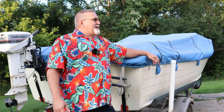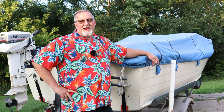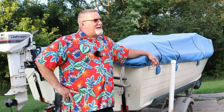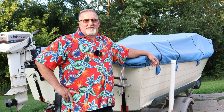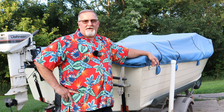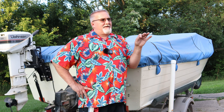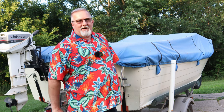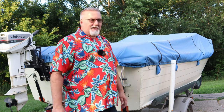Fine. What'd I do? I put a 30 amp on there thinking, oh, that's enough. Well, it was enough for my old trolling motor. It didn't draw the amps that this Ulterra will draw, and a 30 amp breaker, when I run it up at 8, I can run it up on 8 a lot. I go 9 or 10. If I go to 10, I can go about 100 yards, and I'm trolling along, I hear a click underneath the seat where I sit for casting. And it'll trip that breaker.